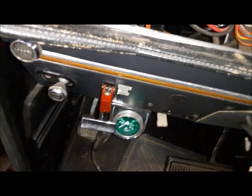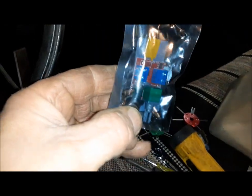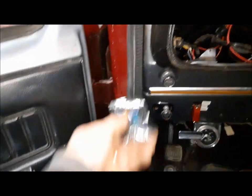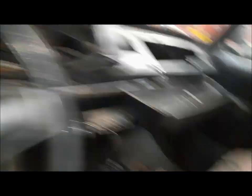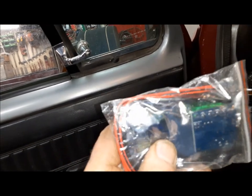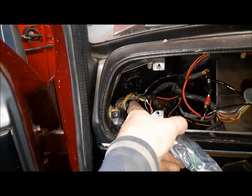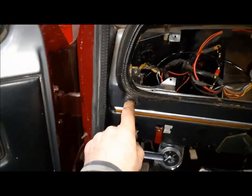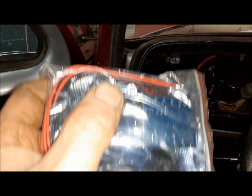There are a couple of ways we can do that. This first one is an independent pulse width modulation device — you wire it completely independent, or in parallel with the dash light switch, and it has its own knob with a pot so you can adjust it. The other one I found converts DC voltage to pulse width modulation, so theoretically it should go in series with the dash lights and convert the analog signal from the rheostat to the pulse width modulation we need. I'm going to set it up and try it before I start hacking any wiring.